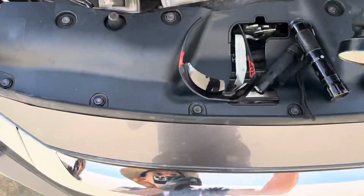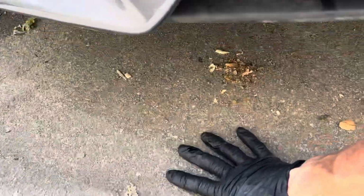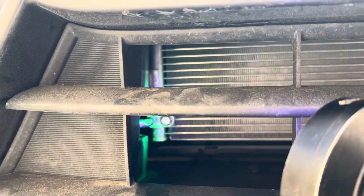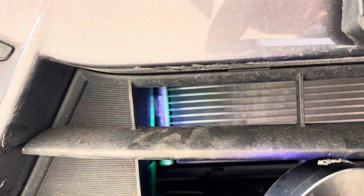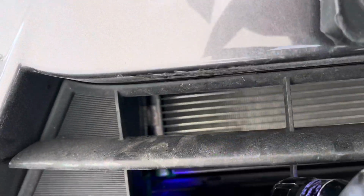As you can see, you could see the squirt pattern down here. This is where UV dye comes in. I could hear it, and it was a little hard to get to. You could see a little bit of the dye right there. It's really obvious now. At first it wasn't, but you could see the mess. And then when I put my finger right at the seal where the nut connection is, it's tight, there's no problem, but it definitely leaked.